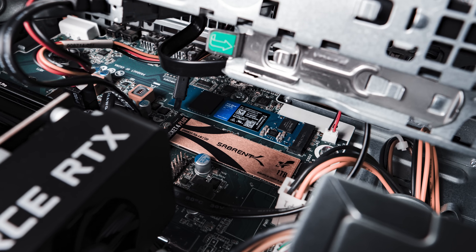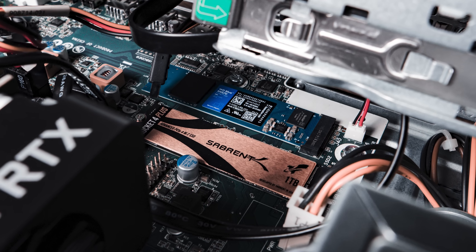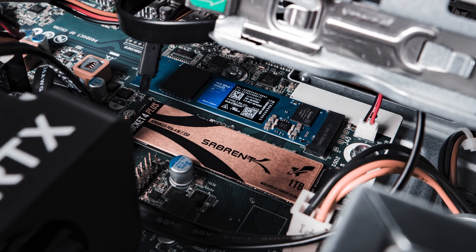Remember when I mentioned the Windows 11 install? I don't know this guy — I don't know what's on that drive. Just because the overall presentation was almost too good to be true doesn't mean I'm going to start blindly trusting strangers on the internet. So I removed the drive and instead installed two one-terabyte drives — one to run a fresh install of Windows 11 and one for miscellaneous. This motherboard has two NVMe slots. I chose a brand new Western Digital Blue for the main drive, and the other is a Sabrent Rocket I had just laying around. If you have random stuff collecting dust, this is a good opportunity to put it back to work. I got the activation key from VIP URCD Key online — it's legit. I'll also link to everything I mentioned in this video down below.